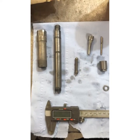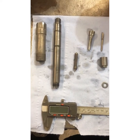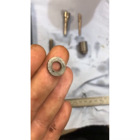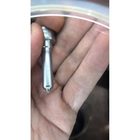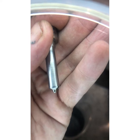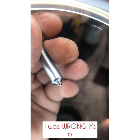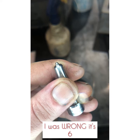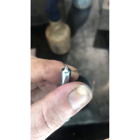What we're now going to do is reassemble. I'm going to find a little tray, put all of this soaking in some diesel, then go for the rebuild. We discard the washer — never reuse the seat and washer, so I'll order some new ones. You can now probably see the little nozzles — should be five. Those little pin holes in the nozzle.